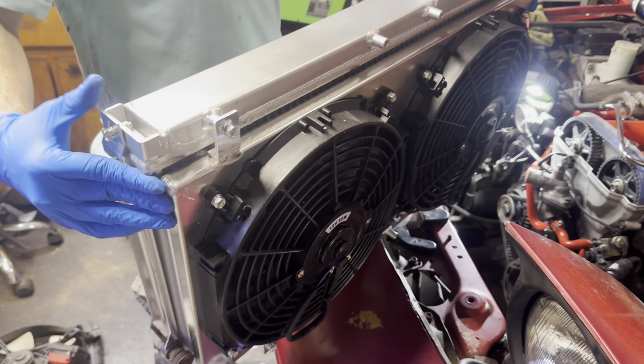All right, now since the car is running and the heat is on, the car is going to circulate all the coolant. So now you're going to see bubbles come out of here, and every time this keeps getting low, you just put coolant in. Now you just have to let the car get up to operating temperature. Now the last step is just putting on this cap.